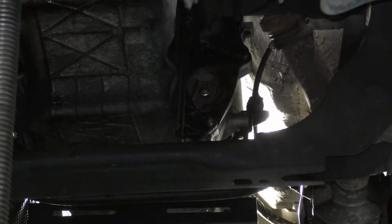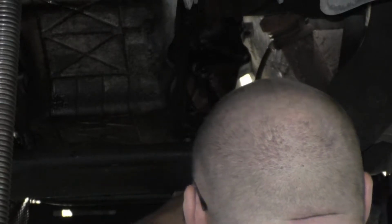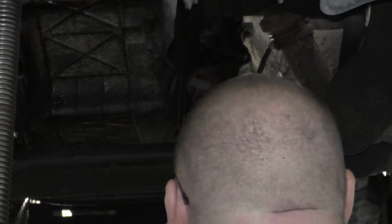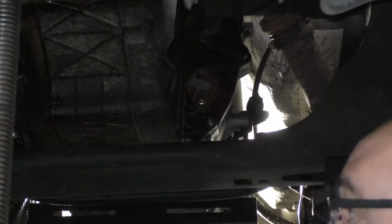Look up the torque converter. Alright, I finally found it. Torque converter nuts, it says 27 foot-pounds. May have to put the bar in there. Nope, we can bottom out on the side there, that works fine. So there's number one.